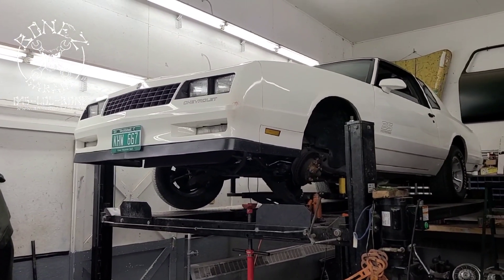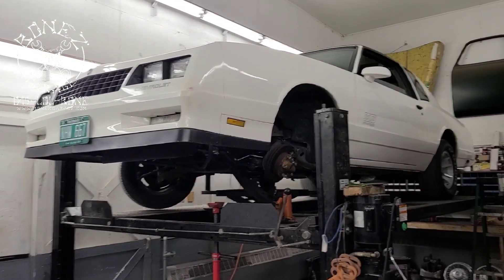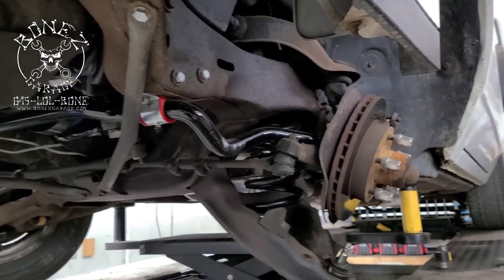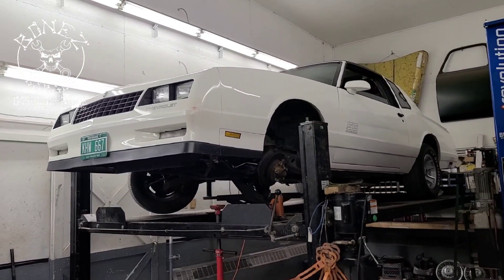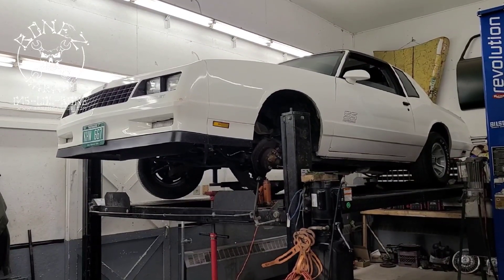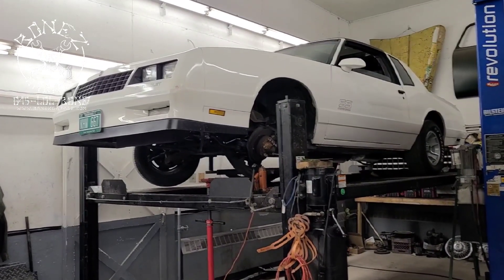She is back in and we're doing all the basic maintenance — tune-up, oil change, checking all the brakes, going through the car. We're also lowering the car; we're getting a set of two-inch lowering springs in here. You can see we already have one of the new springs started, and we have this nice heavy-duty sway bar in. I'm really looking forward to seeing this thing down two inches because this thing sat super high in the nose, which made the handling unruly — it kind of wandered and when you got up to speed you could feel the front end floating.